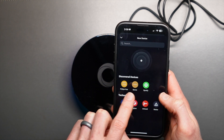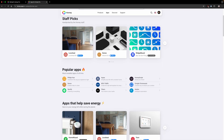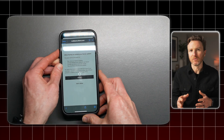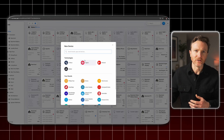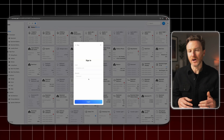Once the basic setup is complete, it's time to start adding smart home devices. From the devices page, Homey Pro will try to auto-discover devices on your network. In my case, it auto-discovered my Philips Hue lights and Sonos smart speakers. You can also choose to add devices by protocol, such as Z-Wave, Zigbee, or Matter. Or you can jump into the Homey app store, where you can see popular apps, browse apps by category, or search for your smart home brands. Each app has a badge to tell you if it's an official Homey app or a community-built one. Installing an app is as simple as clicking install. Once an app is installed, some apps will require you to go to settings, open the app, and click configure — there you may need to provide account login credentials or other information like a device IP address. But most apps don't require visiting settings. Instead, once the app is installed, just go to add a new device, find the app under your brands, tap the app, choose the type of device you want to add, and click connect.